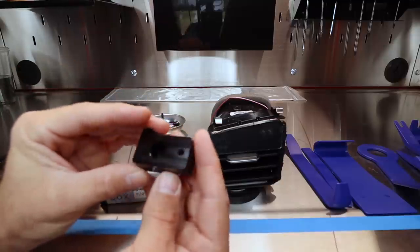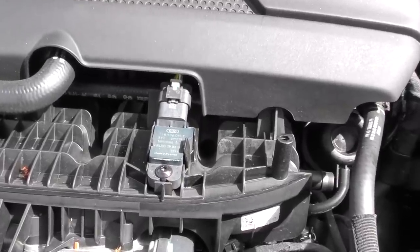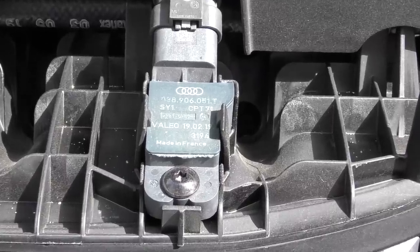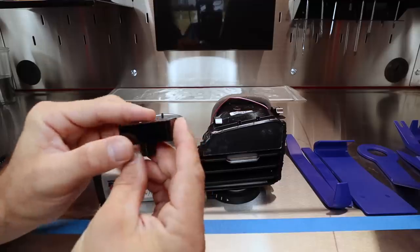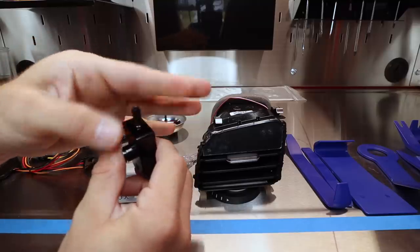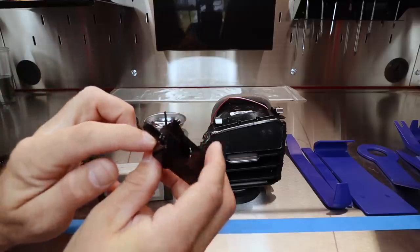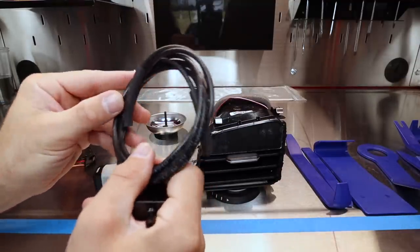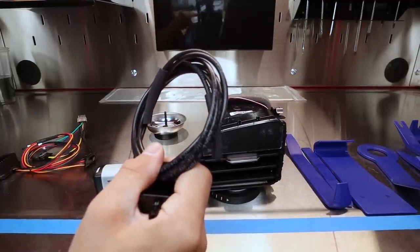For the boost tap, if you go that route, this piece installs right where the intake air temperature sensor is. We're going to take the intake air temperature sensor — which is right on top of the intake manifold — out, and install this. There's a little nipple here. We'll put some thread tape on it and run our hose. The worst part of this job is probably going to be routing this hosing through the firewall or through the bulkhead.